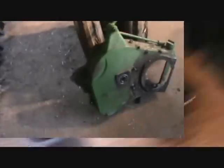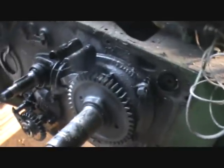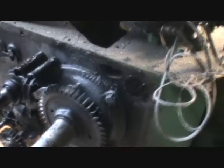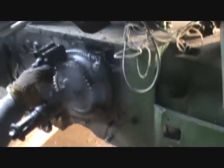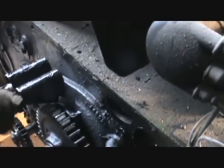We got that cover off pretty easy. Hopefully they gave me the right gaskets - I paid $200-some dollars for the gasket kit. Tim right now is pulling the wires off. You've got to take the wire completely out of there - you can't just flail that wire around, you'll bend it. This is the rear main bearing - the right-side main bearing - and I have a new one of those too. We're just trying to get that stuff out and we'll have this crankshaft out of here in no time.